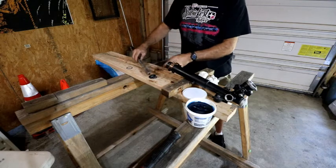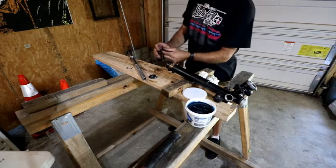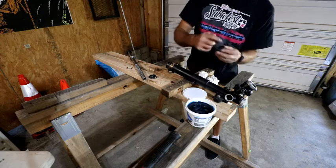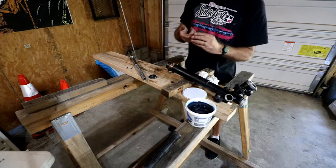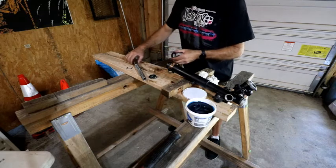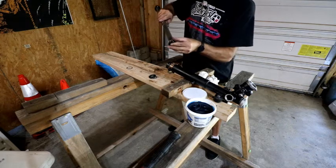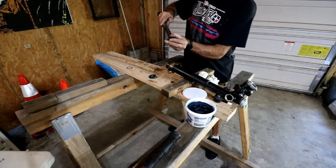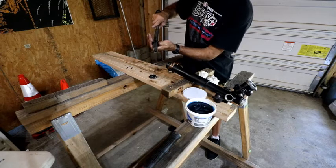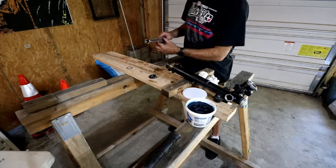So now I've got to put my two seals back on here, and I'm ready to slide the rack back in here and then use my slide hammer to pull it down. These two, this one will face with the U towards the center, and then this backs up right behind it. So I'm going to throw some grease. Well, I should probably put it inside, huh? I need to be very careful going over top of this that I don't damage the seal. And that is a tight fit. So I'm pushing this direction to try and keep it off those teeth. That's on. My new little gray thingy, easy peasy.